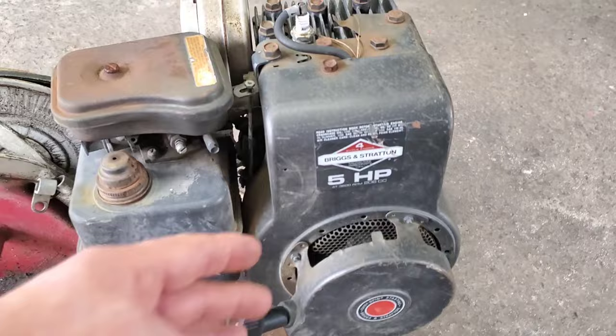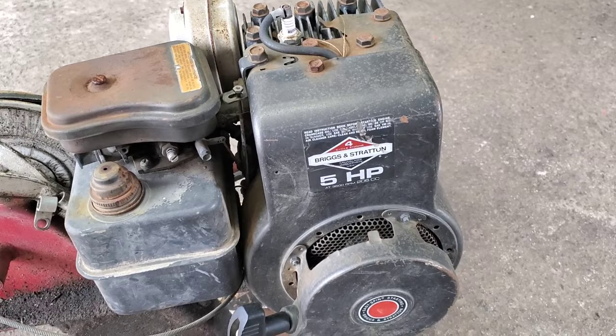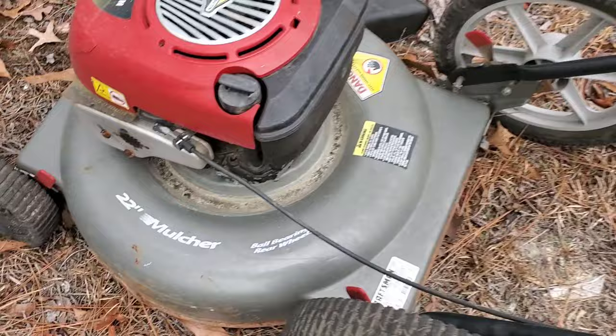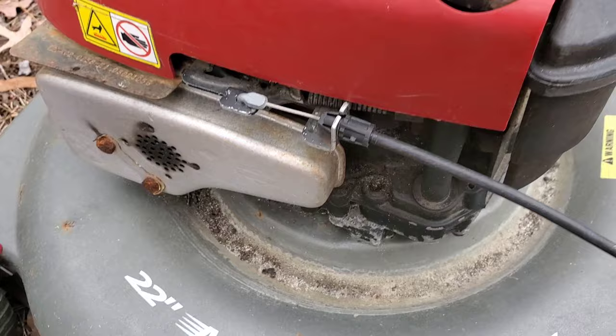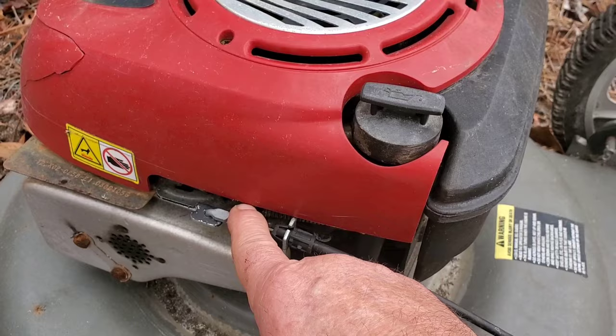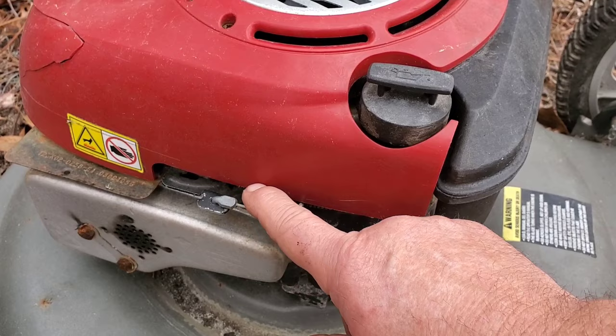You can do the same thing with this little engine: pull your engine cover off, disconnect the kill wire, same procedure — too easy. On a push mower, you have to pull this handle down and that releases your kill and puts a brake on the flywheel. If you pull this cover off and disconnect that wire and all of a sudden you have fire, the problem is going to be in here where that wire runs over to the kill switch. Sometimes this cable will stretch, this can bend and make it just enough so it grounds that wire out and kills your fire.